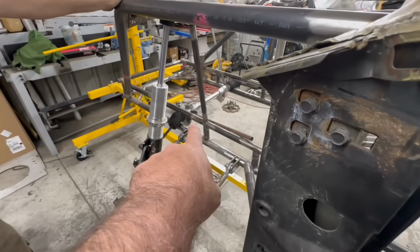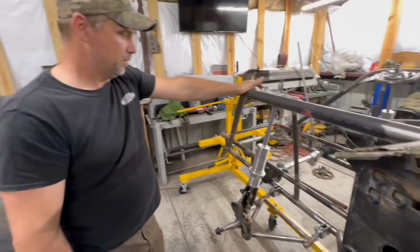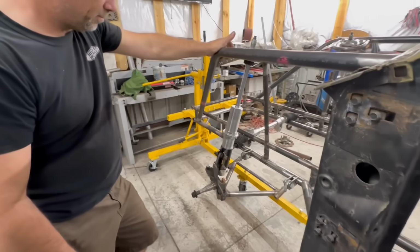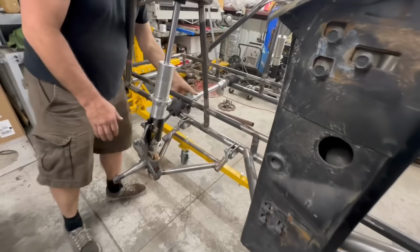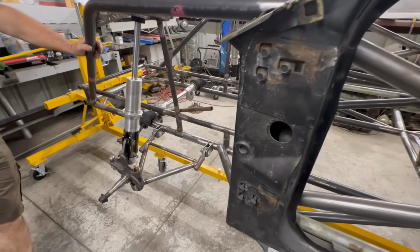Now, it's got a Mustang rack and pinion up there. One of Courtney's buddies is making some aluminum bushings. It's going to basically mount just like a Mustang. We're going to mount the rack back in it and get the bump steer set up on it and be good to go. And he'll figure that height out. The rack will come up just a little bit, right? And then we've got to clear the headers and the motor plate and everything, so I don't know exactly where to locate it until I put everything back in the car. But that's no big deal.